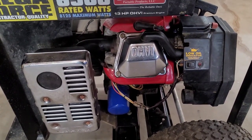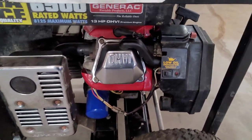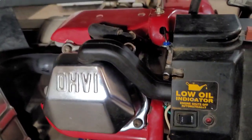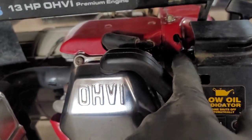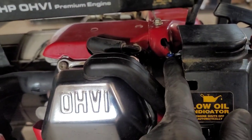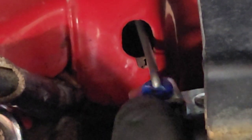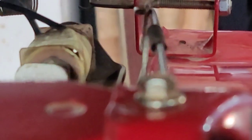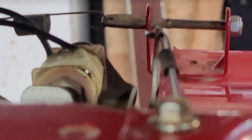Here's the engine all put back together. I apologize I wasn't able to get it all on camera, but I wanted to note a few things to look out for if you ever take this machine apart. Over here is the part that was missing — I just changed out the arm and put it on the original carburetor. In order to get it through, it goes through the recoil housing and, as you can see past there, it moves the governor arm.